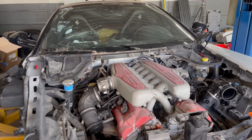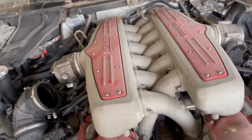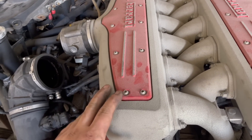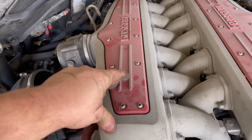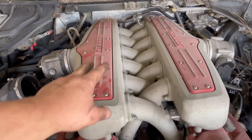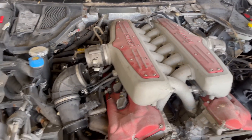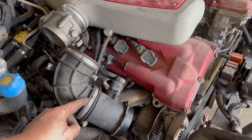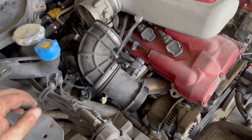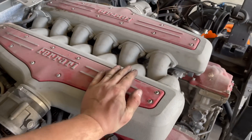We got everything removed. I also took off the hood and the cowl piece so we can get to the bolts in the back. I'm thinking you just loosen these 10-millimeter bolts and it slides over. I might have to watch a YouTube video to see exactly how to take off these plenums — either there's something under there or it's just for looks. These little rubber connectors are terrible; over time the rubber erodes and everything becomes super loose. We'll replace those with screw-together clamps and go ahead and take off both plenums.